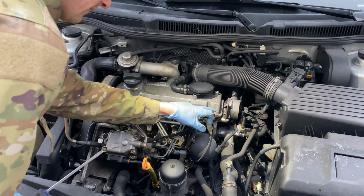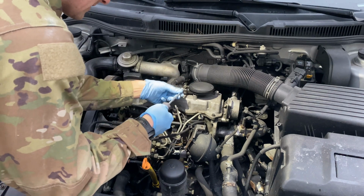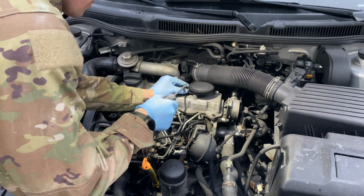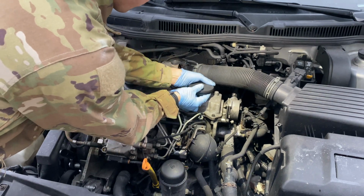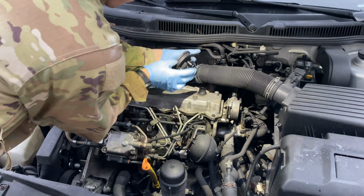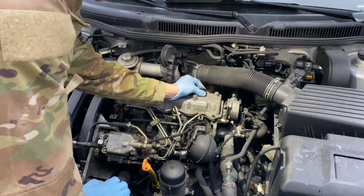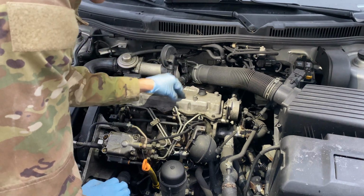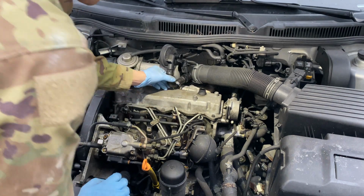To remove this valve cover, we need to remove these 3 front bolts, and there's 4 in the back. We also need to remove this little crankcase breather, so we'll just undo this little hose clamp. Now we can just carefully pry up on this crankcase breather. If your grommet here is leaking, I have a video on how to replace it. It's really easy. You just basically pop it out and put in a new one. Now's a really good time to do that when you're doing this valve cover as well. Again, I have a video that I'll make sure to link below.